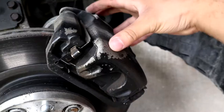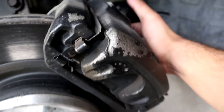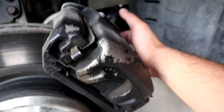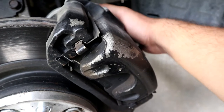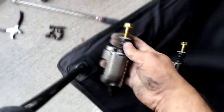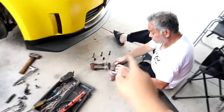So this is the caliper here — this is the part that has a little bit of play. It's not even that much, but this is what we suspect is causing all the noise, and it's getting super loud. I was just about to throw this on and I noticed the play on the new caliper cradle is actually even more than the one we're replacing.